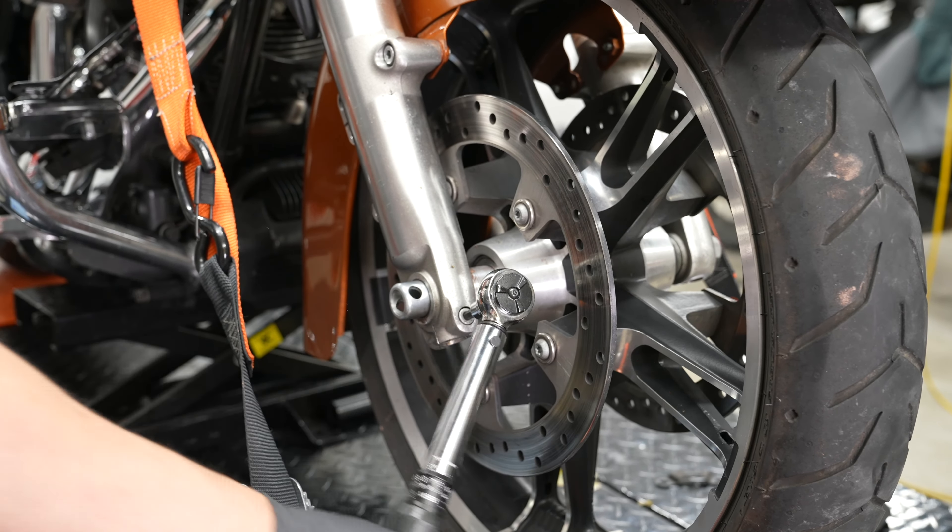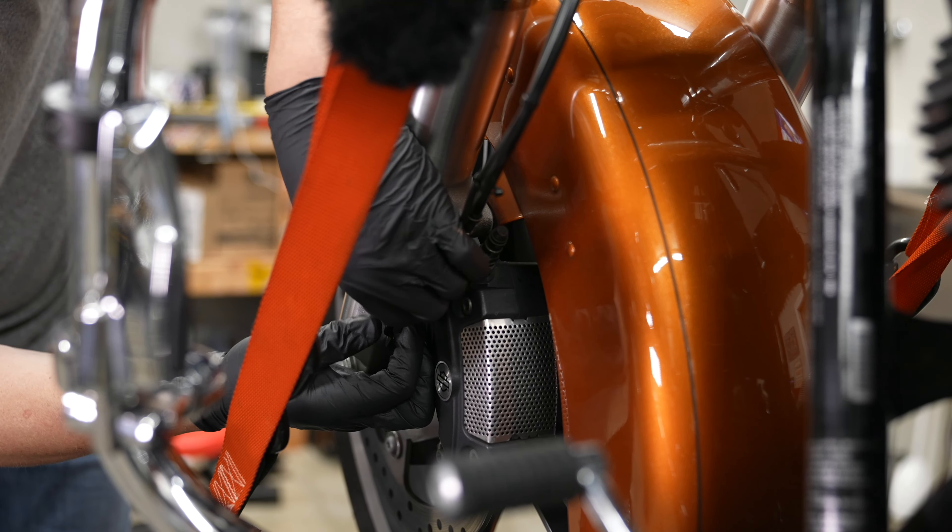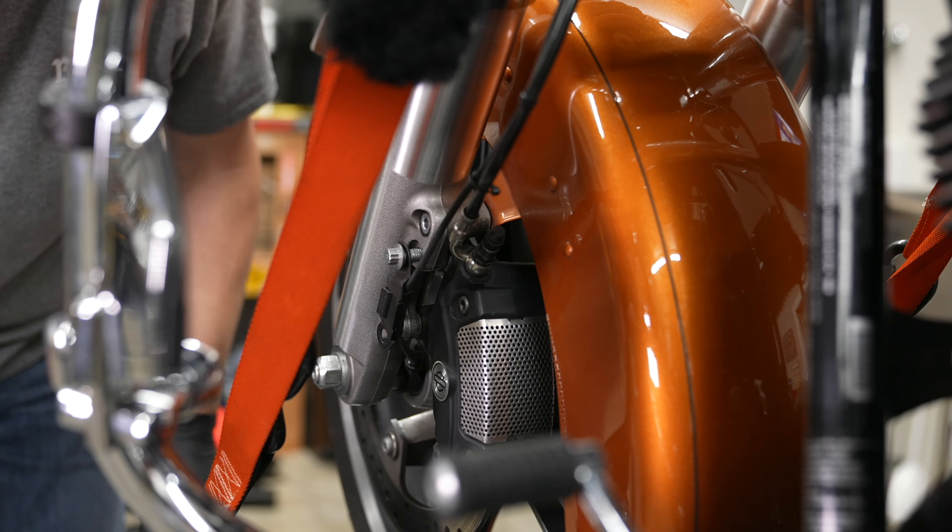Now we're going back on with both brake calipers. Make sure you spread the brake pad plates apart so they fit over your rotor — you can use a screwdriver, just take care not to mar them up. For the left side brake caliper, once the cheek plates are spread apart you can fit it up over the rotor and line the two bolt holes up. Don't forget there's an additional plate on the left side — a stock bolt and washer — and that little plate guides your ABS sensor wire. Then go in with his 10-millimeter 12-point socket on those brake caliper bolts and get them snugged down. He'll do the same install on the other side, minus the ABS wire.